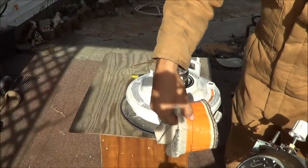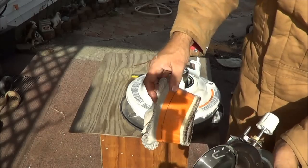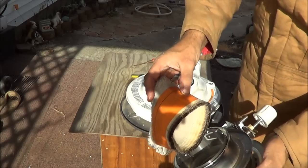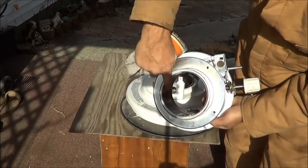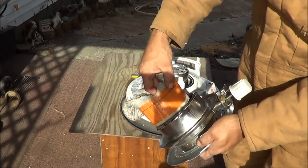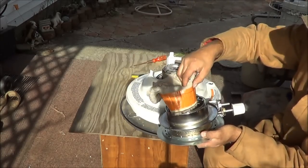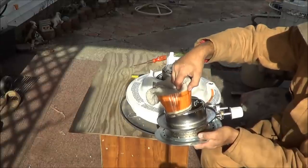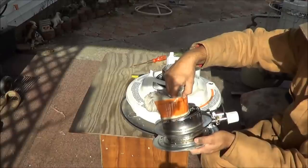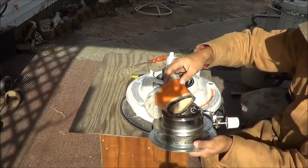You've got a line on a lot of these wicks, and that line is what you line up to the bottom edge of your wick holder. Now some will just have set pins — a little peg sticking out — and the wick has to go over those pegs and you can't move it at all. This is where you start out new. Some will have many lines on it because they'll fit different models. And if your wick does get burnt up, sometimes I'll move the wick up just maybe a sixteenth or an eighth of an inch above the line, and that way you can go again with it.